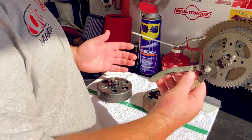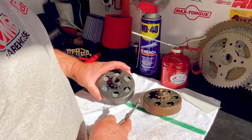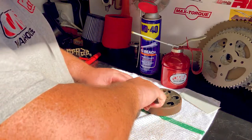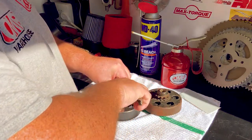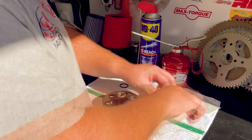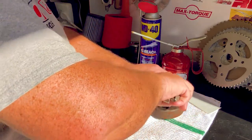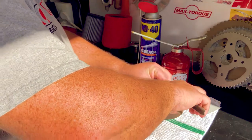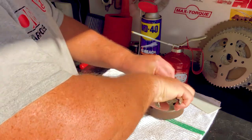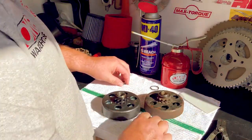To maintain these clutches, a pair of snap ring pliers is very helpful. I'm going to take the snap ring off the inside of both of these clutches so you can have a look and see what's going on. This old used one has some very hard miles on it. It has a stepped hub, which tells me it was a two-stroke cart clutch at one point in time.